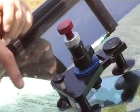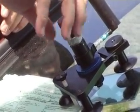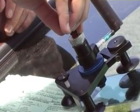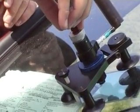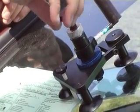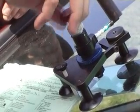Then once it fills all the way in like that, you just back up your piston knob until you feel it disengage from the threads. Give it a slight pull back, about 1/4 of an inch more, just let it draw in there. What that does is it back flushes the bullseye, pulls some of the resin right out of the break, and pulls any latent air out right with it. And then just pop this back into place, put it back under pressure again.